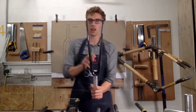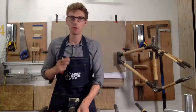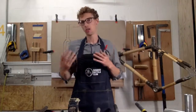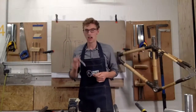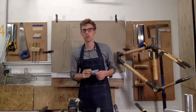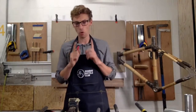So say you started with a narrow tyre and you suddenly felt, hang on, I'm doing a bit more rough riding, track riding, you know, on canal trails and so on, and you wanted to increase the size of the tyre, you won't be able to do that with the fork you've picked. So just be really, really careful on the fork consideration.